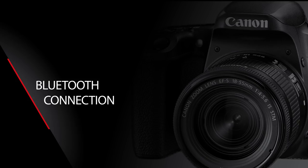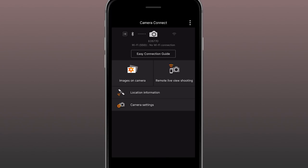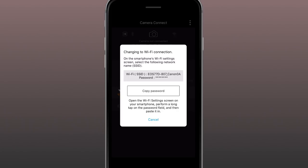The first step is to connect the camera's low-power Bluetooth wireless to your smartphone. This will keep a steady, low-power connection between the camera and mobile device as long as the camera is turned on. When the Camera Connect app is instructed to view images, download pictures, or remote-control the camera, it temporarily shuts off Bluetooth and switches to the stronger Wi-Fi signals. Some smartphones may not have Bluetooth capability or may use a version older than the Bluetooth 4 used on the EOS 77D — if so, just connect exclusively with Wi-Fi.